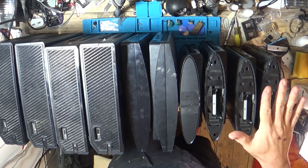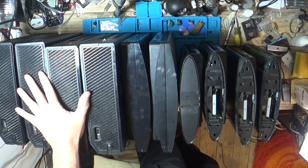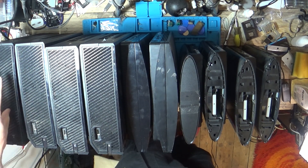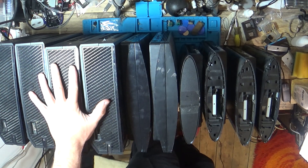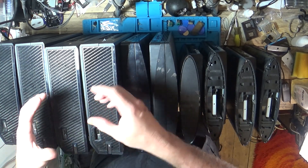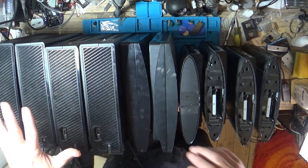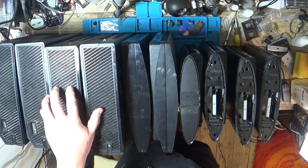Here we are on the overhead - all lined up, 10 consoles. When I went around there, the Xbox Ones were already pulled out. The first one does work but doesn't read discs, so hopefully that's just a drive swap - I've got spare drives. These three he didn't want much for because they turn on and turn off again. Depending on how quickly, it could be a shorted power rail or something else internally. If it's a long beep on, beep off, we'll test them. If they're simple fixes, I'll give Jack more money for them.